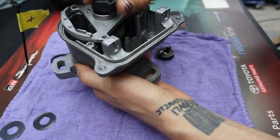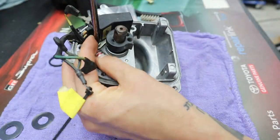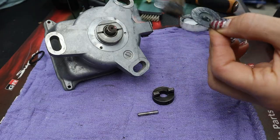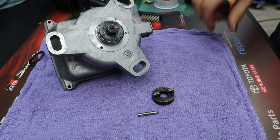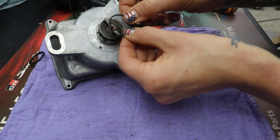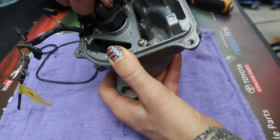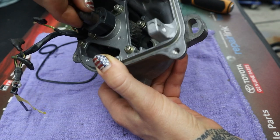Alright, the first two magnets are installed, now for the center shaft. After the center shaft is in place I can fasten down that last magnet with those two screws as well as install those three shaft plate screws. Now flipping the distributor over to install the washers, coating them with a little bit of grease before install, then placing the key back onto the shaft with the groove facing the side with my paint mark. This pin only goes in one way — if you can't get it in one way just put it in the other. Then securing that pin with the circlip. After it's installed, rotate the shaft and make sure it spins freely — you should also feel the pull of those magnets, so it's gonna feel a little bit notchy when you turn it.